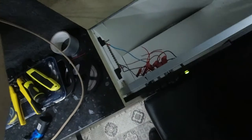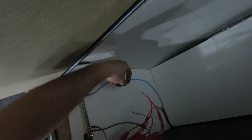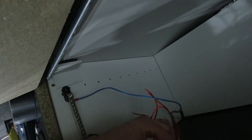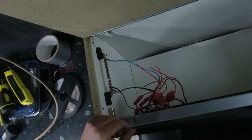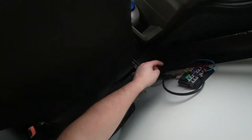What I did was feed a cable underneath my kitchen cabinets - it's a bit snug but it's not going anywhere, I will fasten it down. I split the cable - negative on this bus bar here and positive into the switch, and then the switch feeds back into the marine panel. As you can see all the fuses are in there. I've put a 20-amp fuse on for now at the far end. The panel placement isn't the most efficient but it works.